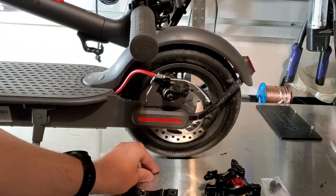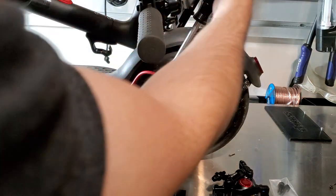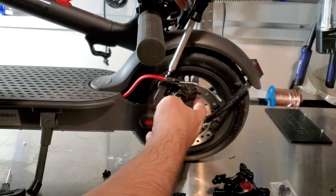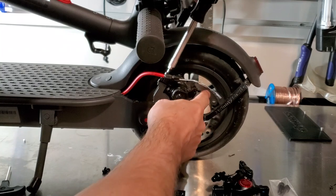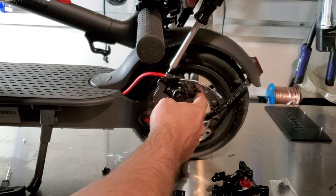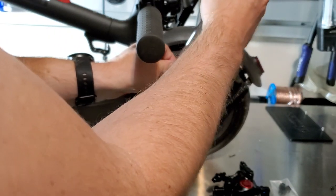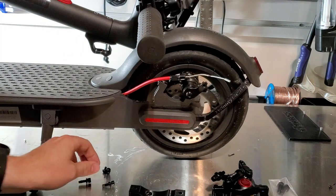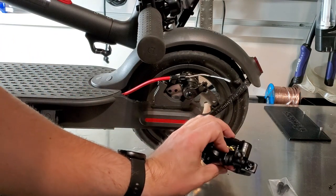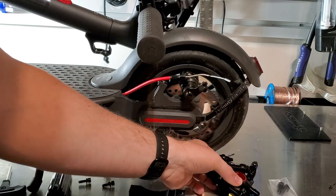I have tested the rear brake down a very steep hill — I'll show footage of that. I turned the scooter off and tried to go down the hill just using the rear brake, and what happened was it massively overheated. It overheated enough that I started losing braking power, and it was actually very dangerous. I could see that the pad was melting black onto the rim — it was a bad time. That's a good testament to why you should upgrade the brakes. These new brakes put friction on not only the front but also the rear, so hopefully that makes things better.